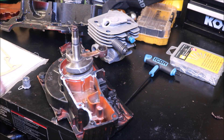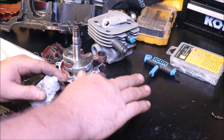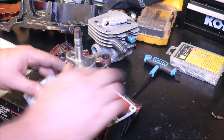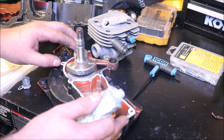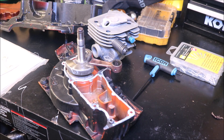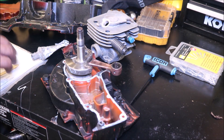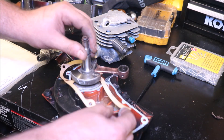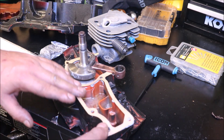I like to just put a thin film of that all around when I get the gasket on and it's set in place good. I know some guys will take that gasket and let it sit and soak in two-cycle oil — that's fine too, it may help it take shape a little better. I don't have the oven and the big freezer anymore that I had over in the other shop. We've got our little mini fridge as a little freezer — you can fit a crank in, fit bearings in. We've got a pretty good heat gun my wife got me for Christmas a couple years back. It seems to do the deed and do it well.